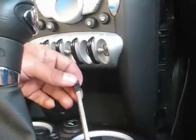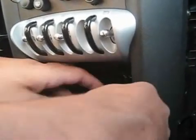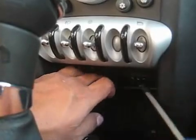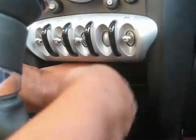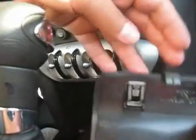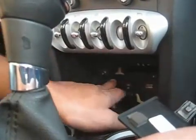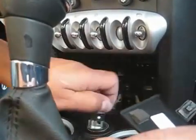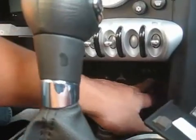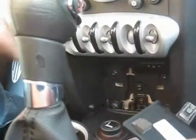Once again with your trusty electrical tape covered screwdriver, all you do is get under here. This is probably one of the hardest parts. You bend this out, put this in, bend it a little bit, and get your fingers in between there, then pull out. Don't worry about breaking it — this just has two pressure tabs, so it feels pretty strong. You'll have three T30 screws, just like the ones you pulled off first behind the odometer. Pull these three out and you can start getting to work on the screws on the sides.